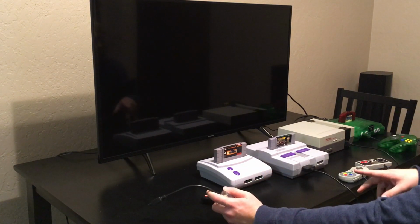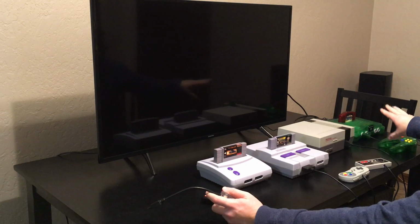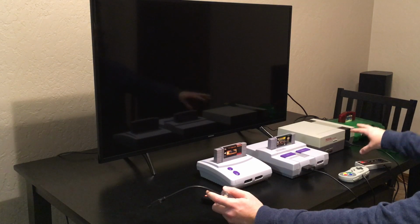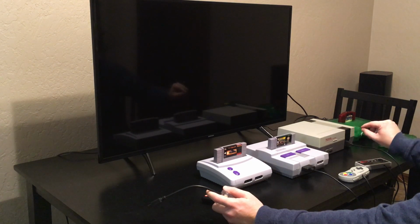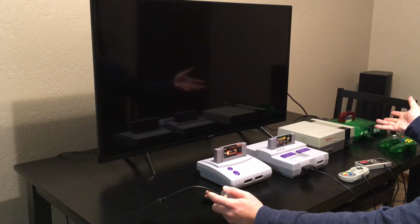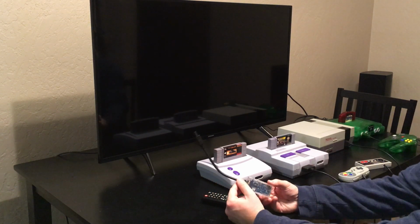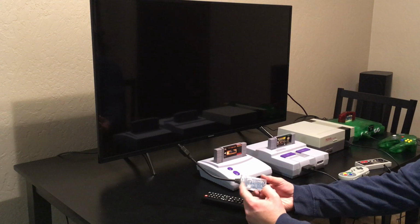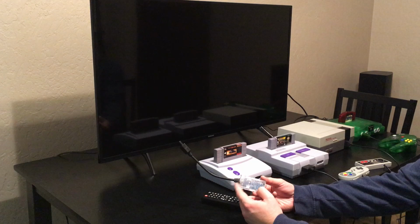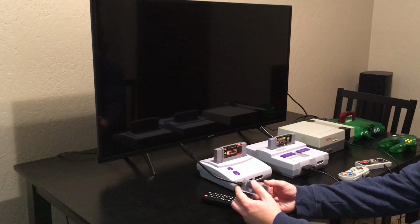On their website, they say that Nintendo 64 RGB works, SNES RGB, and AV Famicom RGB works. I'm not sure if they just didn't list the US version of the regular Nintendo, if it's been modded for RGB, or if it won't work. Another cool thing is that if it detects RGB, the light will go, I believe, purple to indicate RGB. If the best it detects is S-Video, then it'll output S-Video. And if the best it detects is composite, it'll even line double composite and output it.